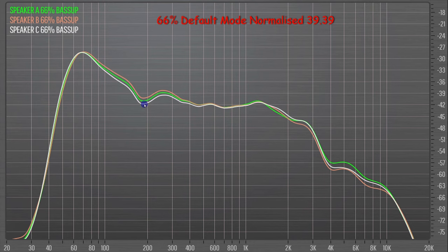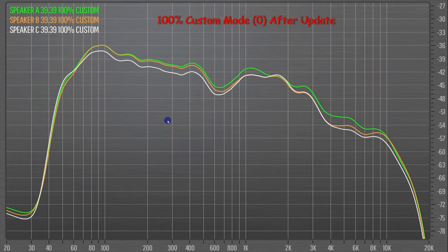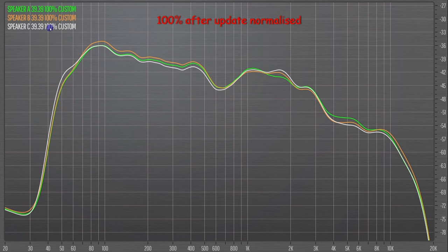Just remember, speaker C does actually play quieter than the other two — this is normalized. And then again, in the high end, there's a noticeable peak for speaker A, whereas speaker C and speaker B are somewhat recessed compared to speaker A at 5kHz. All three speakers after the update: again, speaker C at maximum volume is just a quieter speaker. The loudest of the bunch is speaker A, thanks to its stronger mids, and from 2kHz all the way up to 10kHz it's stronger. If we normalize them, we can see speaker C has the deepest bass and the biggest peak around 1800Hz. Speaker B has the most in terms of mid and upper bass. The deepest bass is least on speaker A, which is going the loudest. It still has the highest peak from about 3.5kHz to about 8kHz.